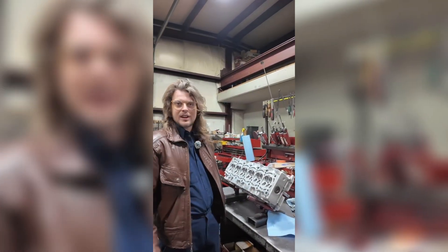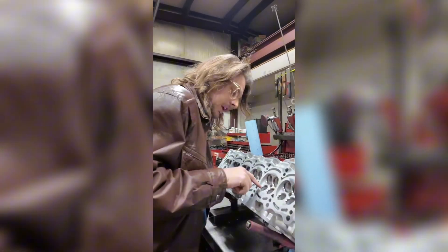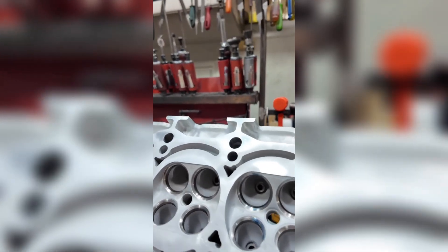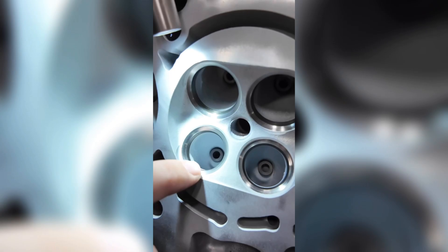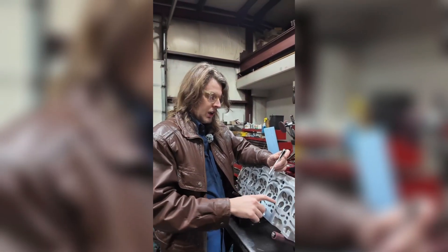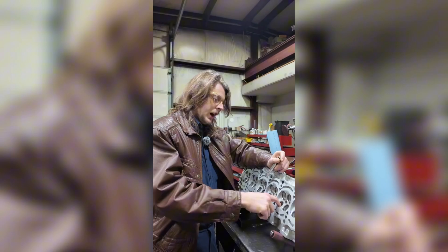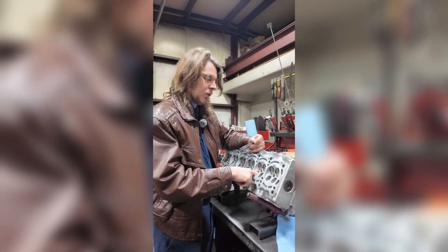It needs some serious port work compared to the beams I'm used to. If you look right in here with the flashlight, you can see the casting on the back side is nice and smooth, but right down on that bottom lip there's a serious flat-to-angled area. That flat-to-angled area is just bad for flow. With a turbo engine, any sort of performance gain we can get will be noticeable.